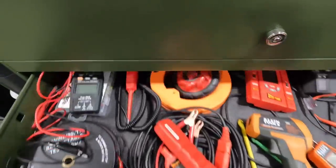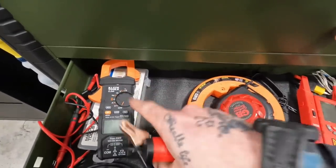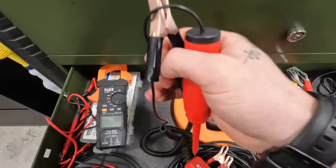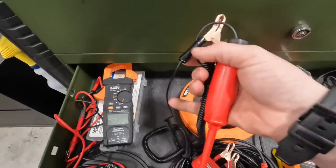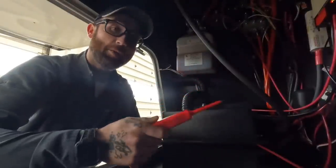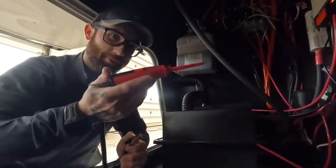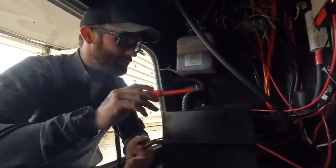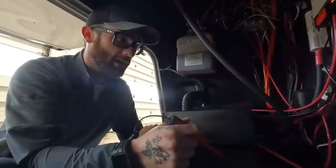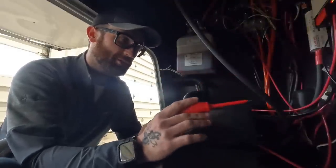The next tool is a test light. A lot of you will say I mentioned a multimeter in the first video — I recommend having that before a test light because a test light is only good for 12 volt, but it's much faster and easier to use than a multimeter. I also only recommend this tool if you know a little bit about electrical. You can't stick this into anything 120 volt or you'll absolutely fry it. You have to know the difference between a 12-volt circuit and a 120-volt circuit. I'll shout out the NRVTA home study course — check it out on my website.